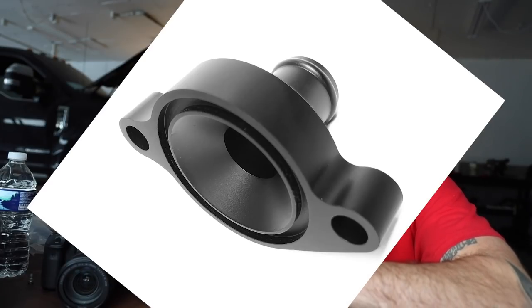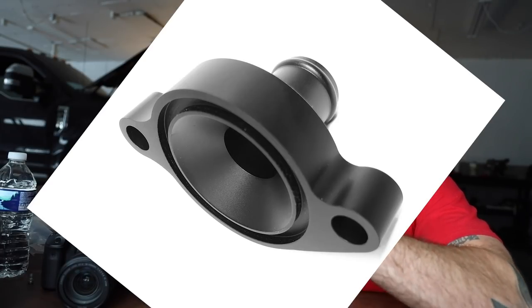There are a couple of kits on the market that reroute the crankcase vent to atmosphere. Most of those kits have a venturi fitting — a little cone-shaped cap that goes on the hole where the crankcase vent comes out — meaning the oil-soaked air will hit that little cone and the oil will remain there, only letting the actual air and gas escape, not physical liquid.